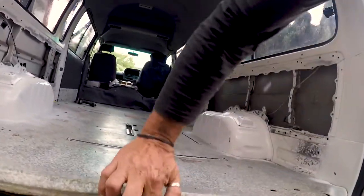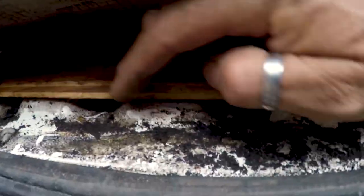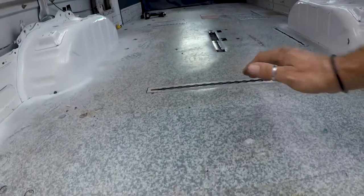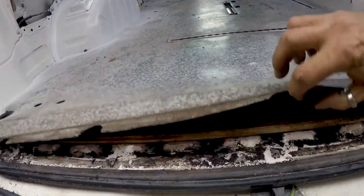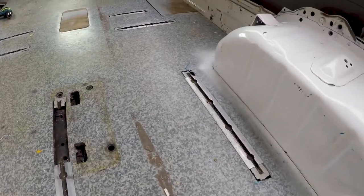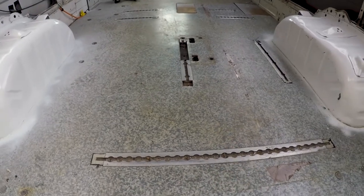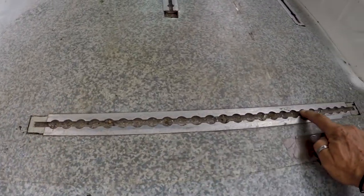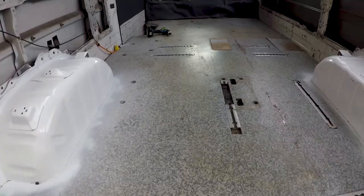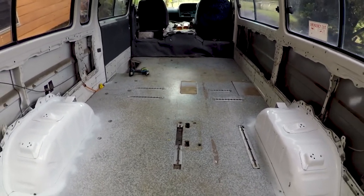Next thing I've got to do now is the floor. Now in most vans like this you'll see the original floor is a bit grotty, and it's got corrugations in it, so you have to put down a piece of ply over the whole floor first to get it nice and flat. Now in this van that's already been done, which is a bonus. But we've also got all these wheelchair anchor points in here — some of them we had to remove and patch with some bits of ply. If we put new vinyl in here, it'll eventually sink into all these wheelchair anchor points. So what I'm going to do is just layer a layer of 3mm ply over the whole lot, so that when we put our new vinyl down, it'll be all nice and smooth.